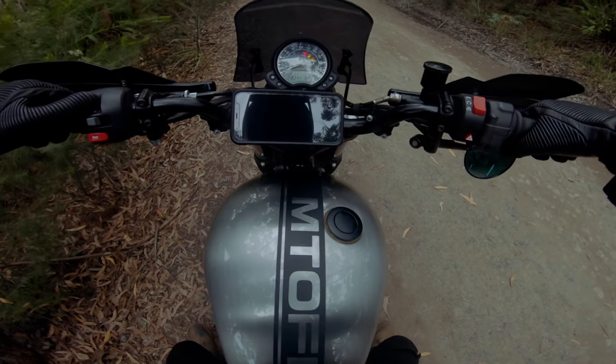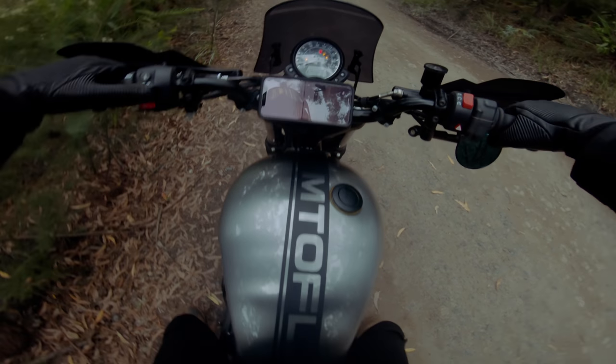When you're taking it off road, you want to switch riding modes — get rid of the ABS and traction so you can have more control. With the later models, you just have different ride modes with an off-road mode. For myself, I need to go through every time and manually turn traction off and ABS off. It's pretty annoying. You can see why they put the modes in there — so much better.